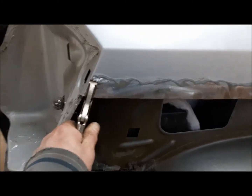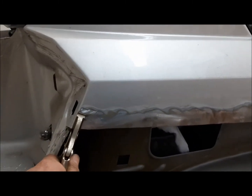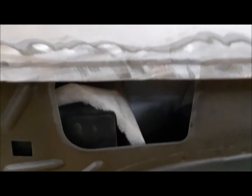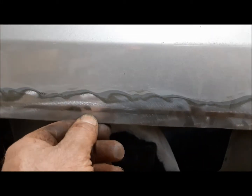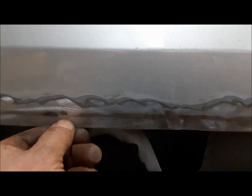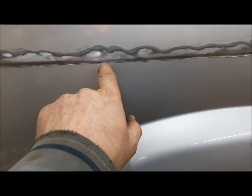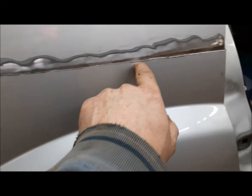You just put it on, give it a squeeze, and work your way down the end of it, but it takes two hands. There you go - you can see our flange put across. Now I'm going to test fit it and make sure that the finished edge of our panel is just below there, because it does us no good if we flange it and then it sits up here. We'll have to take just a tiny bit off, but that's no big deal. At this point I'm not worrying about it - that'll be a kind of a final adjustment type thing.